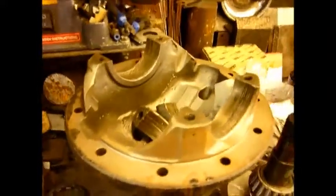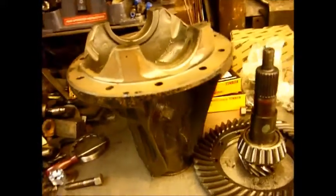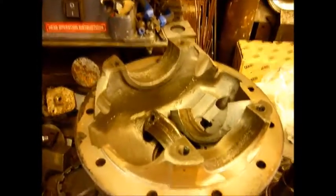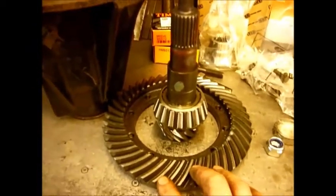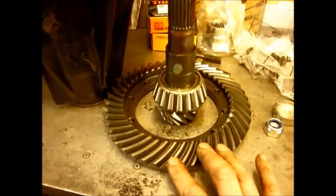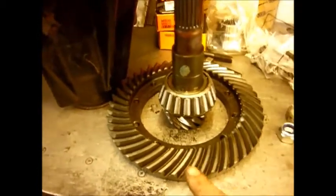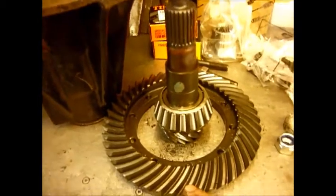So this one we're using because it's got this filler here. This will be further cleaned and repainted - the coating on it is just really to save it going rusty - and it will be fettled up. We'll also be supplying a crown wheel and pinion. This is quite a late 3.54 crown wheel and pinion that came off a good diff - it's been checked, it's okay - and that will be cleaned up; you almost won't recognise it.